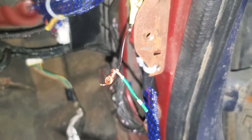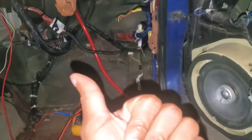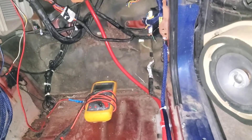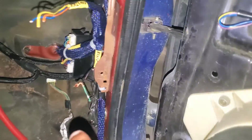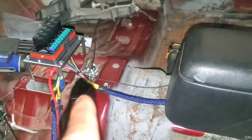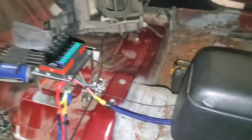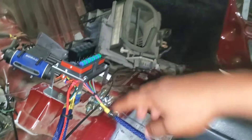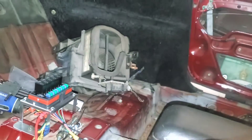To explain why I'm not using the ECU output wire for the fuel pump: from what I was given from Link and from Wiring Specialties, the Link ECU outputs a low signal to the fuel pump relay to cut it on. The only way for it to work is to connect this switch to one side of the relay control, take the ground off the ground, and put it to power — basically reversing the polarities for the circuit. However, the other thing is the relays would only work properly if they get power during ignition on, and not constant power.